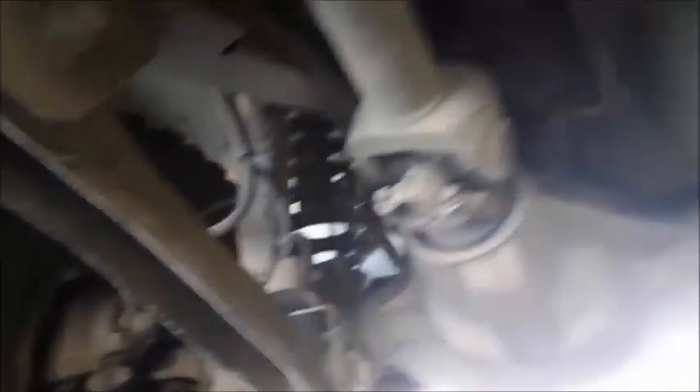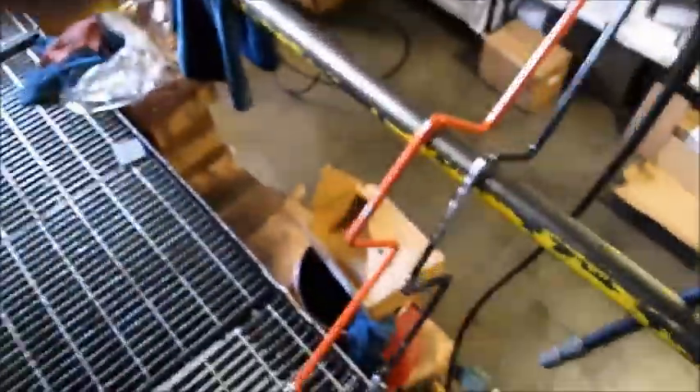This is most four-wheel drives — if they go under water, you will have to lubricate them. That dust we keep talking about will destroy this stuff if you do not keep it out. It is very abrasive and destroys seals. This one has a front solid axle, transfer case, CV joint. If they have lubricatable Zerk fittings, by all means lubricate them. I used to do it every single weekend I went down. If it was really bad, I would do it so the water couldn't sit in there — when you force the grease in, it forces the water and the junk out. Hit that subscribe if you like, and we'll continue.